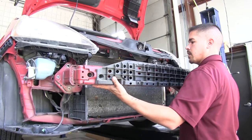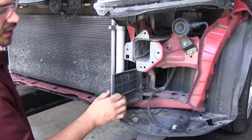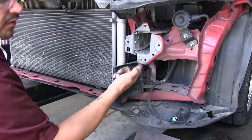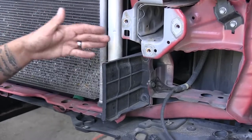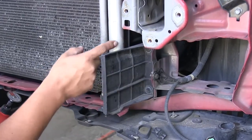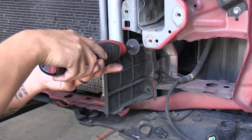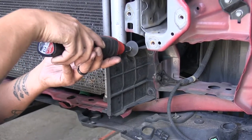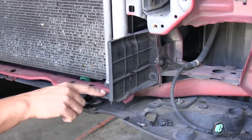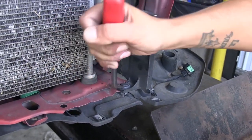Take our bumper beam, lift up and pull out, and set it aside. Now on each side where the bumper beam was mounted, there's a plastic piece alongside the radiator. We're going to want to trim this so it's pretty close to even with the bottom of the flange where our bumper beam was mounted. You can use a utility knife or a rotary tool — just be extra careful because it is extremely close to the AC condenser. Once cut, remove the plastic pushpin fastener on the inside so we can pull the trimmed section fully off the front of the vehicle.